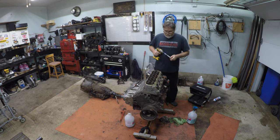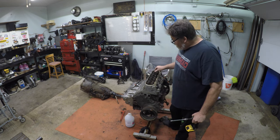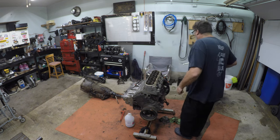My question is why is it lifting up? Valve spring pressure — that's why. I'm glad I'm changing these rocker arms. Look at the wear on them. I'm glad we're going to be putting some new better arms in.